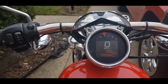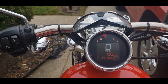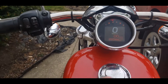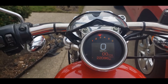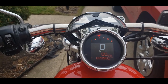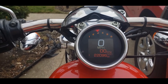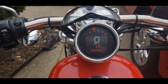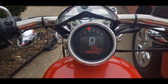The thing I don't like is setting the speedometer. I went to a local cemetery that's rather large to try to set the speedo using my phone's GPS, following the instructions. It sounds pretty simple — you just hold a speed and then use the button under the back of the speedometer to go up or down. But holding a speed long enough to actually move that button isn't very easy. So I ended up pulling over, downloading a 'Map My Run' app, and using the Auto-set on the speedometer DD unit.